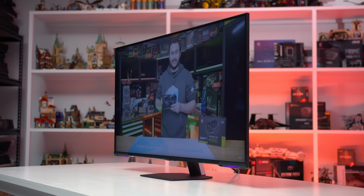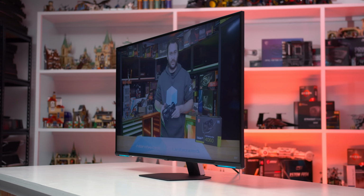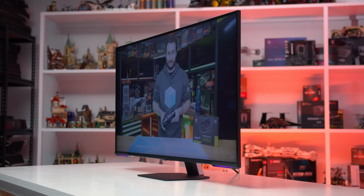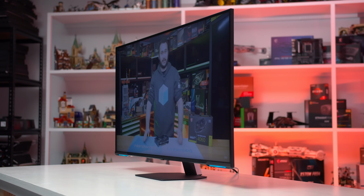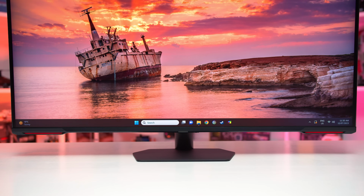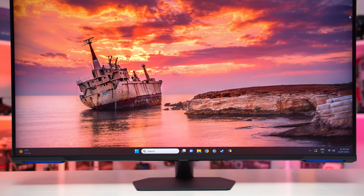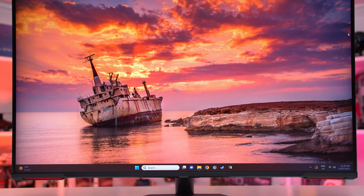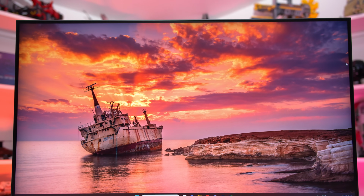Another significant downside to this panel is its viewing angles. We're not talking TN LCD level bad, but a flat VA of this size isn't ideal, and when moving your head around, you can easily see contrast shift and washing out at off angles. The best experience with the deepest blacks is only available when viewing it mostly in the center. But even then, viewing angles impact the corners of the screen, which appear a bit washed out relative to the center, almost like there's a uniformity issue.